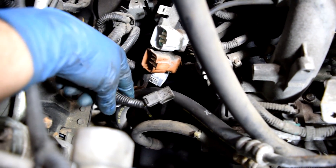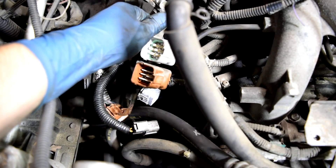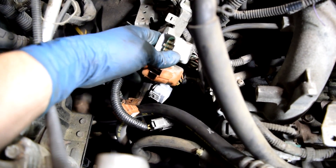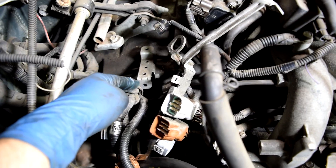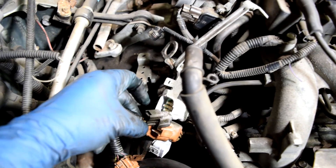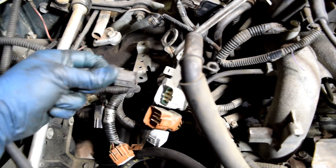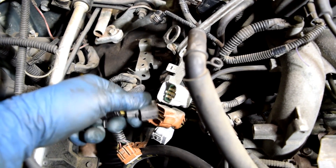So I just spent 10 minutes trying to get this bottom connector off. I actually ended up putting this connector in this bracket that holds the connector for the wiring harness. It's only held in by one 12mm bolt up here. The way you remove this is — it's going to be resting in like that onto this bracket. You got to press down on this little tab in the back of it, and as you press down, you pull. But even though I was doing that, it was stuck on there really good and it took me a good 5–10 minutes to get this off.